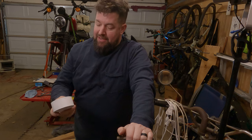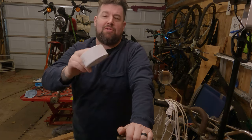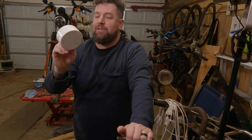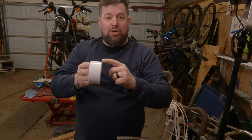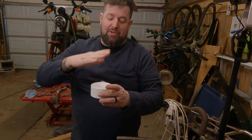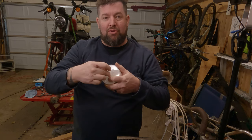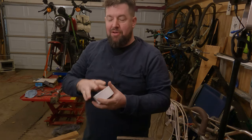What I'm going to do is use a 3-inch PVC cap I picked up at the local hardware store — about $3, or with inflation, $8 by the time you see this. I'm going to cut the top off and take a piece of flat stock, drill a hole in it, and I'll demonstrate over on the bike. It'll work just like the tool, I promise you.